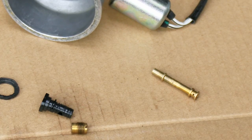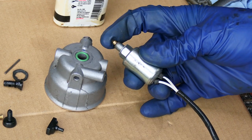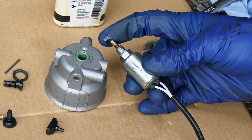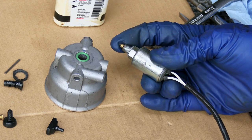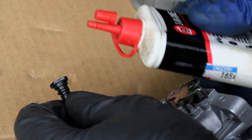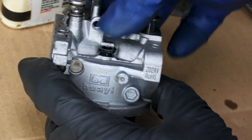Once you get all that stuff clean, you're going to want to put everything back together. But before you do, you want to take out this solenoid and test it to make sure it's any good. These things should move very freely like that. If you push that down and it takes a week to spring back, then it's junk. I've tried cleaning these things up, I've tried oiling them - nothing ever seems to work. So if it doesn't respond, then it probably needs to be replaced. You can also plug this into those two wires you disconnected from the motor and turn the key on and off and watch that plunger move back and forth to make sure the magnet's working right. There's a tiny little O-ring here that may be hard to replace if you break it, so be careful when you're pushing that back down in there. I would take some oil and put just a drop on that O-ring. Slow and steady is the key on that - don't get in a hurry. Just kind of push until it seats all the way down.